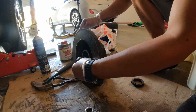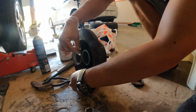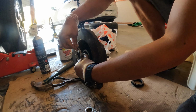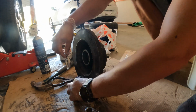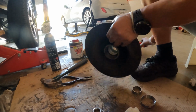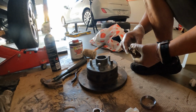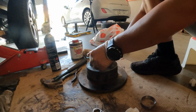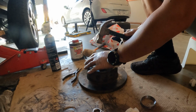And so the inside of the hub, you get the metal plate that'll sit and it locks it all in place there. And then you've got your rubber seal. So to install the new race inside the cleaned hub, that goes onto there, and you can basically just hammer that straight down.